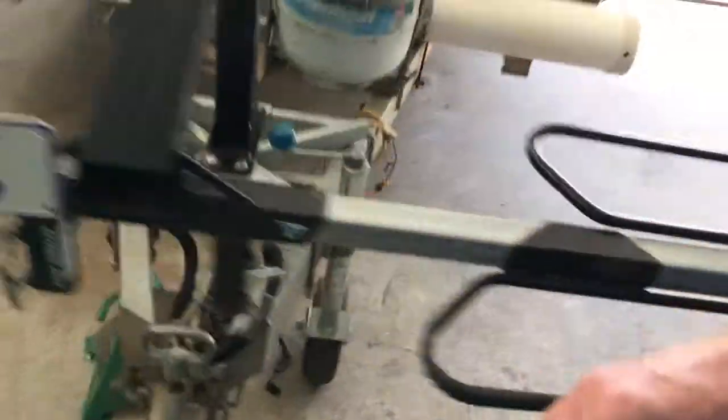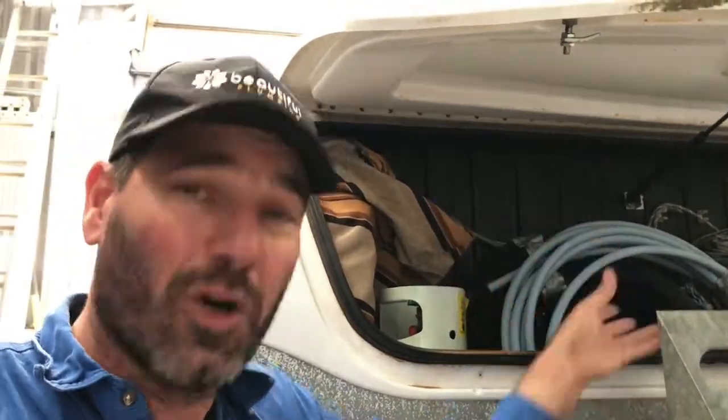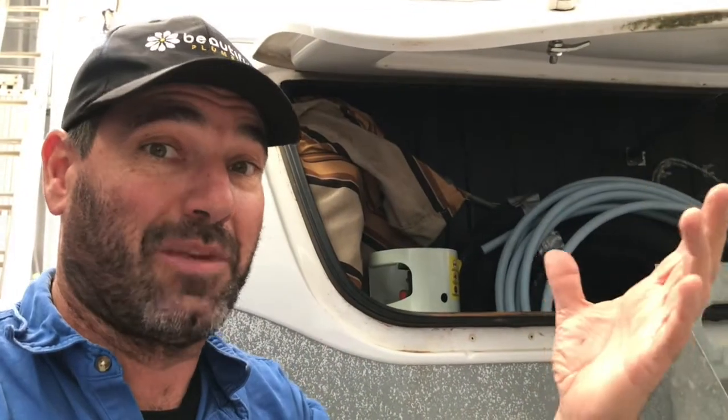He's got a great bike rack out front, and when I asked about a second bottle, he said he just stores it in this compartment up the front. That's not a great idea — if that bottle ever leaks from the valve, this whole compartment is going to fill up with gas because LPG is heavier than air. It just sits there like in a bucket, and if there's a torch or a battery drill in there as a source of ignition, the whole thing could blow. Also, if it is an LPG locker, there needs to be a red reflective sticker so firefighters can identify LPG bottles inside. Normally a locker needs to be fully partitioned off with a vent in the bottom and all that.